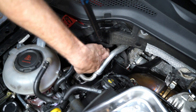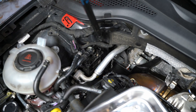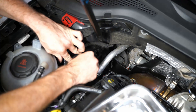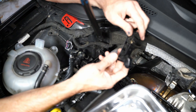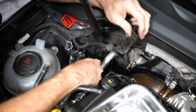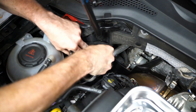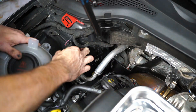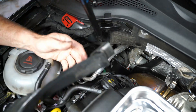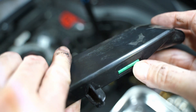There's a little place you can pry — a little tab — that has it attached to the side of the engine compartment. Once you get all that done, you can loosen this thing up and pull off that top. Now you've got this long L-shaped piece that you've got to work out, and it was kind of a pain to get out. There is another place you need to pry apart down on the bottom. And then there's this green clip that captures the two fuel lines running side by side.